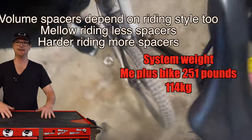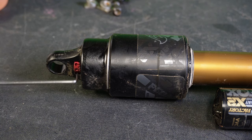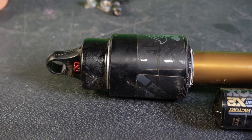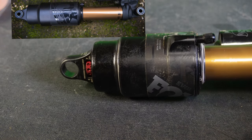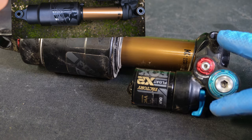I'm not gonna ride it quite as hard because I am a C-plus rider. If your shock has this dial right here, that means it's a second-generation Fox Float X2. If you have no spinner back here, you're in luck because the older Fox Float X2 had more adjustments.